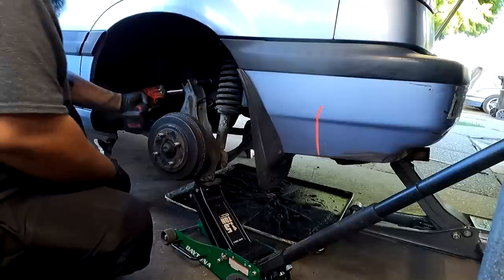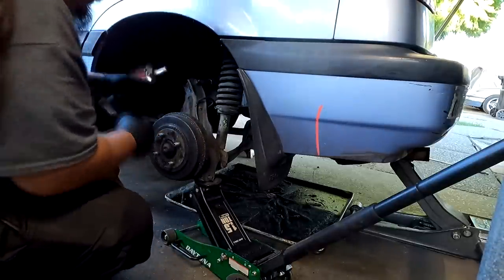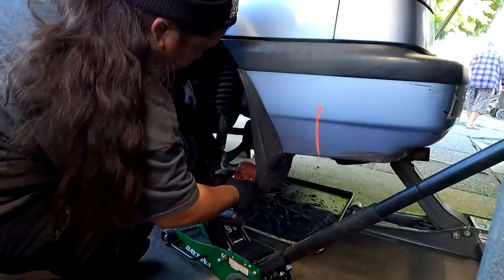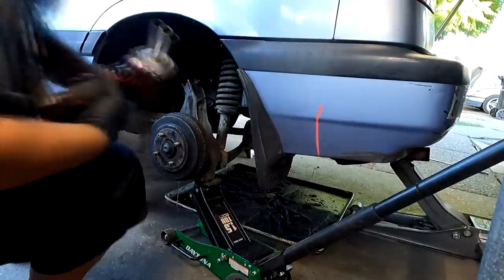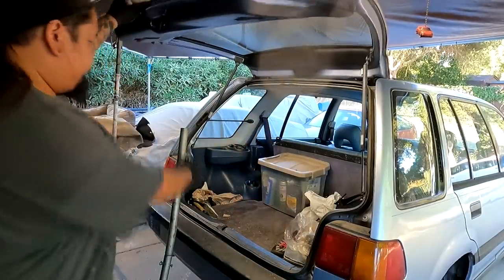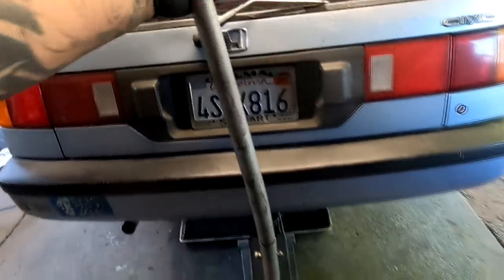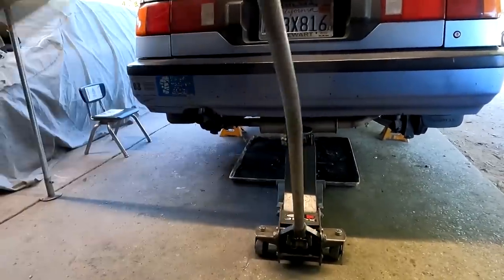Now we do the camber arm. I'm going to zap it all in now because it is loaded. Installing the driver's side was less than 10 minutes — we got it on. The car is obviously not high enough for the wheels to go on, so I've got to max out my jack to put these monster tires on.